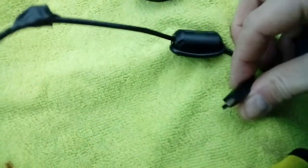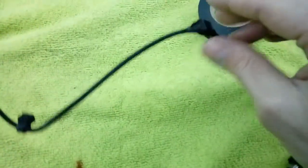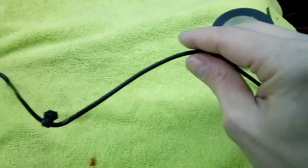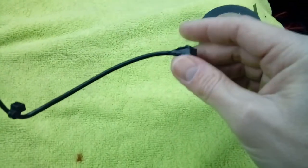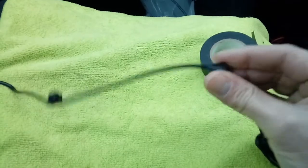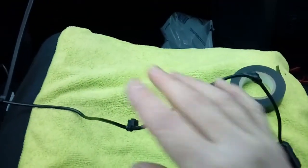Leave enough cable so that it can bend, because it's obviously going to be at an angle when it comes out of the roof. The reason I put cable ties on is to secure the cable better in the headlining. There's nothing worse than driving along, hitting a pothole — and let's face it, British roads aren't that great — and the cable comes dangling down in front of your view. Just beef the cable out with a couple of cable ties, then wrap them in tape because your headlining is made of a fiber material and the sharp edges might rub into it over time. Cover them over so they're not sharp.